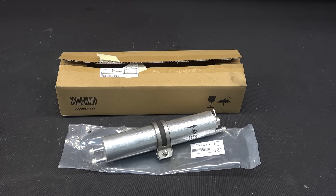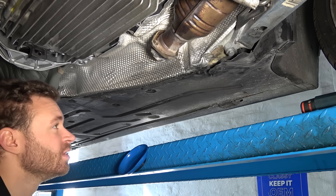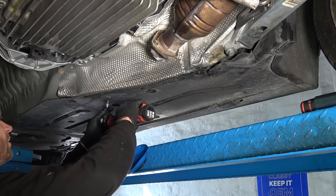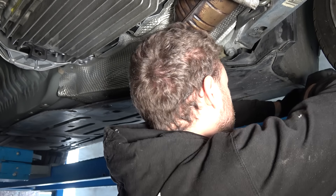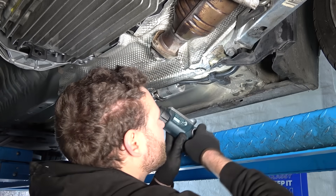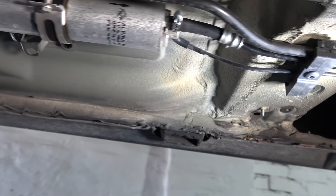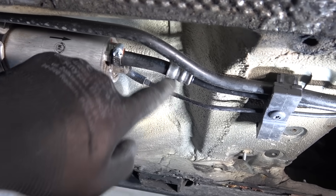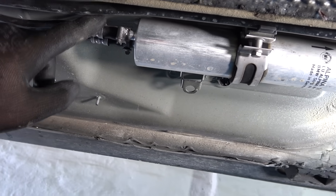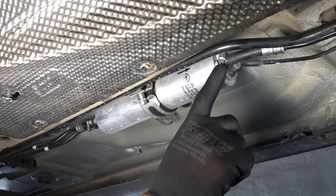We have freshly cleaned injectors so a fresh fuel filter is a must. The fuel filter lives right over here, which means we have to remove this plastic cover. The car did have a bit of a whoopsie on both sides — someone bottomed out at some point — but it's not too bad. There's the fuel filter, and they made a soft rubber line bonded with the metal one, so when this perishes you have to replace the whole thing. Doesn't look too bad in this case, so we're just going to replace the filter.